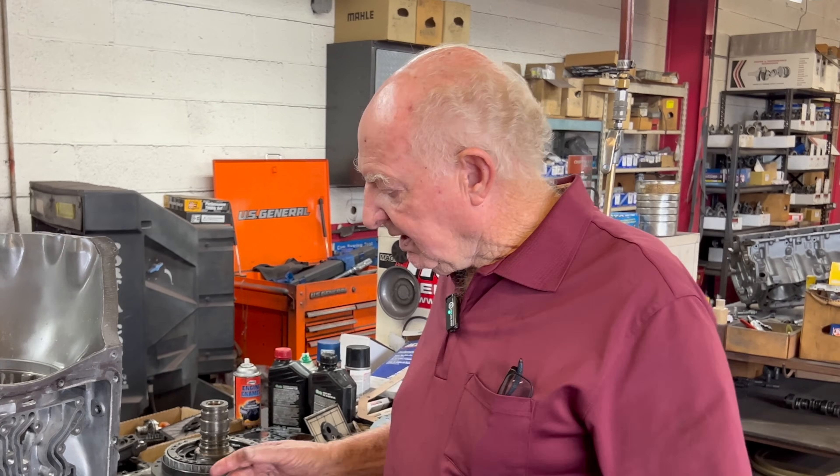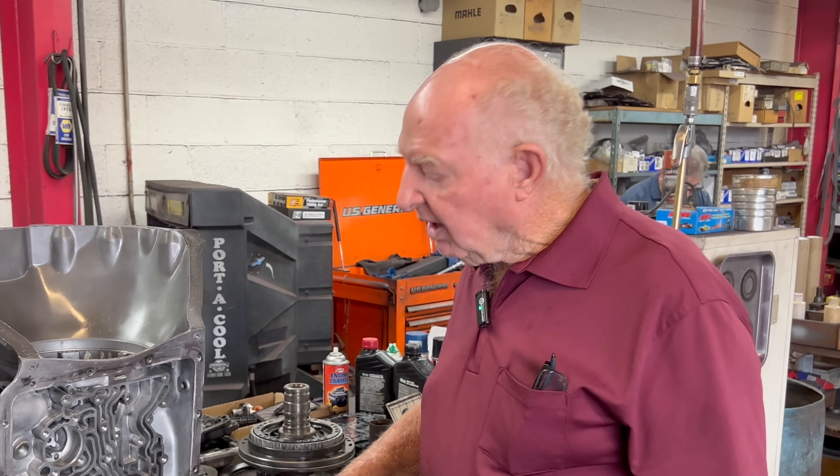There are governor springs you can change so they don't swing out too much, but let's get back to today. This one I tore apart for an old guy I do transmissions for — he just wants to put them on the shelf for someday. We put shift kits in them and rebuild them. He wants me to get it done. So we took this one apart and somebody had put stop leak in it.